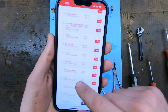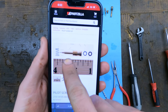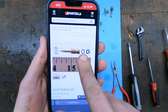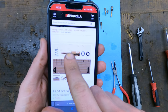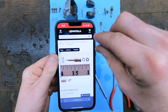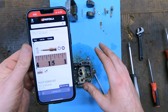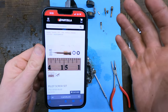So if I scroll down here to number 25, you can see this is what it's supposed to have in there - the fuel screw, the spring, the washer, and the O-ring. It's going to go on in that order. You're going to take your fuel screw, slide your spring over it, then take your steel washer and put that over the end, and then take your O-ring and put that on the end last. The O-ring will kind of hold on to the end of it so you'll be able to hold the whole assembly and it won't fall apart. I'm going to end up ordering a kit, but we're going to finish this up so I can get you guys back on the trails.